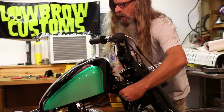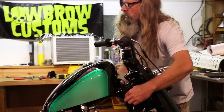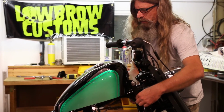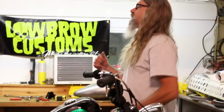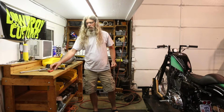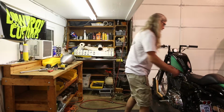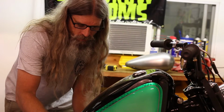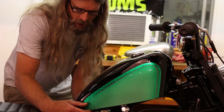If you do have a vacuum type fuel valve, you'll need to remove the vacuum line from the back side of the fuel valve. The majority of the tanks we stock will accept a 22 millimeter or 1/4 inch NPT, and the majority of the valves we have in our store are going to be the non-vacuum type. The vacuum line is not needed if you're going to put a different valve on, as long as you're using a vented gas cap.